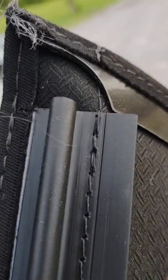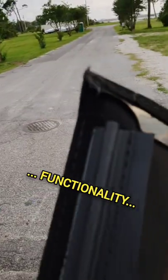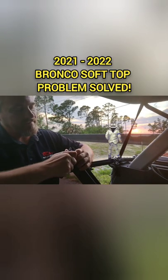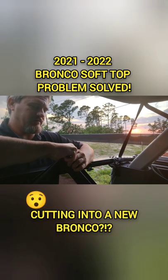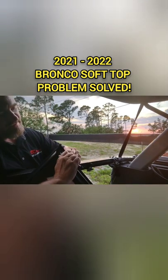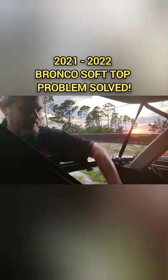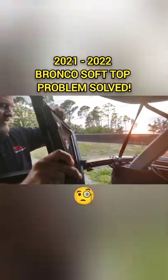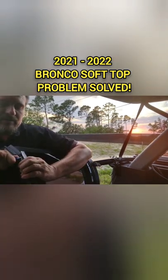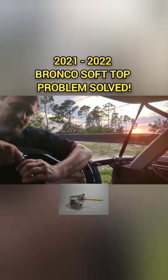So I'm gonna round that flat spot off and I believe it's gonna help me a ton. I know it's not gonna compromise the production of the top. What I'm gonna do here is just take a little razor knife and trim off the very edge of this flat hard surface, because this is what's getting stuck in the tracks. The very first time I tried to get this off it took me about 15 minutes to figure out how to get it off — that was the passenger side, but the driver side came off easier. A hard surface going into a hard flat surface is not as easy as a rounded one going in.